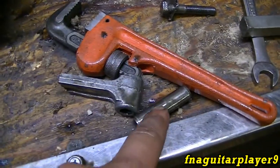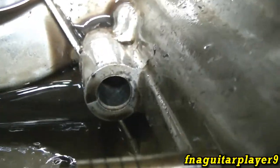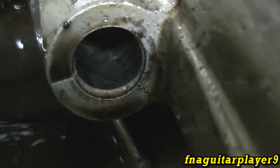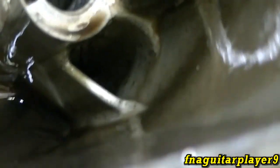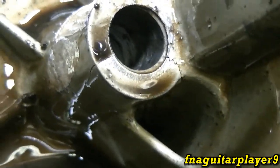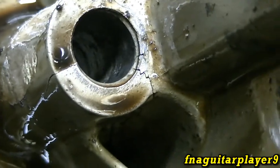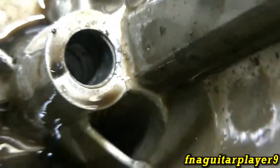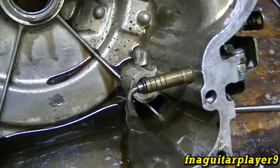This pin right here that holds the rod goes in this hole. If you look, it's cracked on the bottom side in two different places — you can see it better from this side. Right in the center of the screen is one crack, and right there is the other one on that side. This whole thing would fall apart if you tried to run it again.